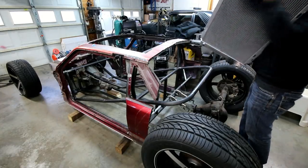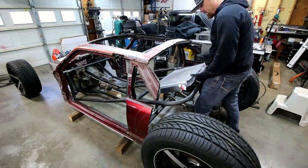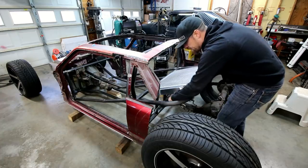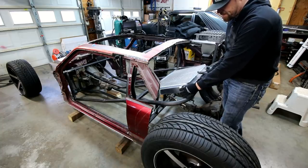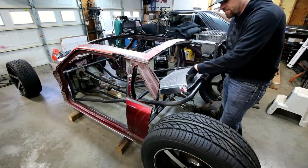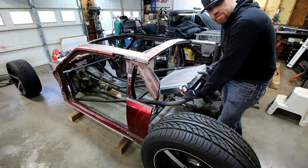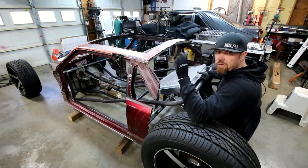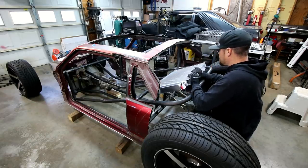Let's see here. So that bad boy kind of fit in there just like that. Like I said, the arm should be able to swing up and down in here like this. I'll probably just cut this neck off and put a 45 degree bend in it and have the top up here so I can fill it back here. You want this top part of the radiator to be higher than everything else in the system in an effort to bleed air. And then what I may do too is put a bleeder up at the front of the engine to let some of that air out. Once I've got all the air out, I can lock it down and not have to worry about it